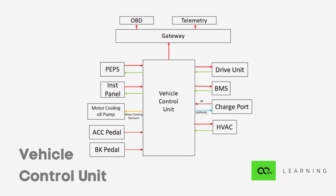The only human-machine output in the vehicle is the instrument cluster — the screen behind the steering wheel, or in between the handlebars in the case of a two-wheeler. There are many telltale lamps which are fairly visible when the vehicle boots up, where all of them are illuminated for a visibility check. The colloquial term for telltale lamps is now the popularized icons visible on the cluster. When the vehicle is facing severe enough issues, certain telltale lamps light up. The VCU is in communication with the instrument cluster, and messaging between them is on a need-to-know basis, apart from frequent communication related to distance to empty and the speedometer.